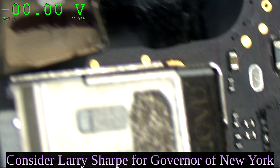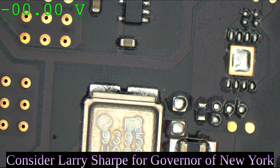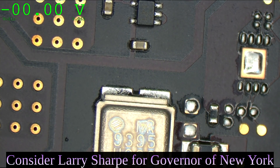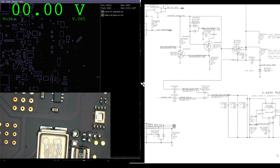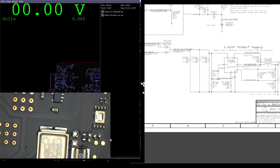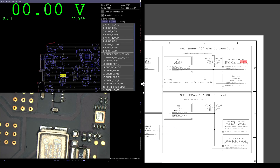But where's our green light? Why is our charger not lighting up? Let's see if our system management controller is turning on. The SMC communicates with the charger but also with chip U7100, which makes our PP bus. The SMC speaks to U7100, which is ISL6259, on a data line. If anything on that data line is not working, and the battery charger is not making the proper PP bus voltage, it likely means the SMC is not running.